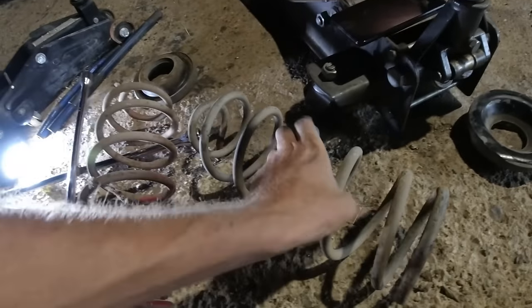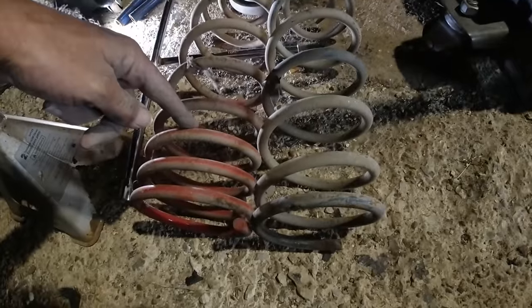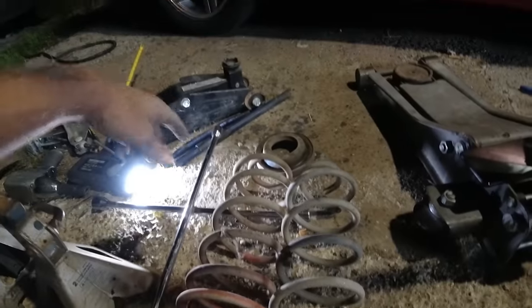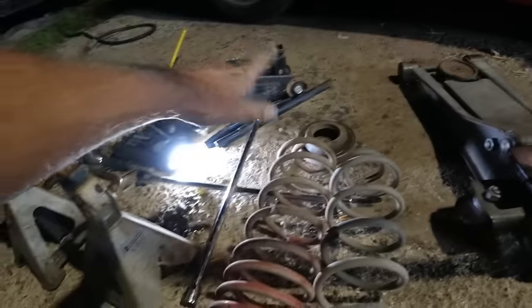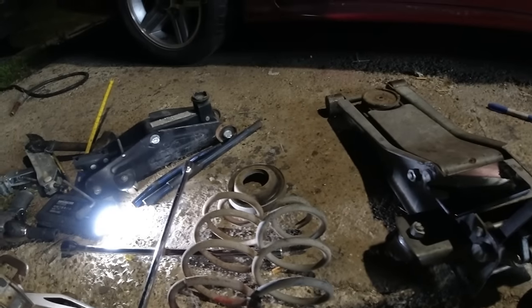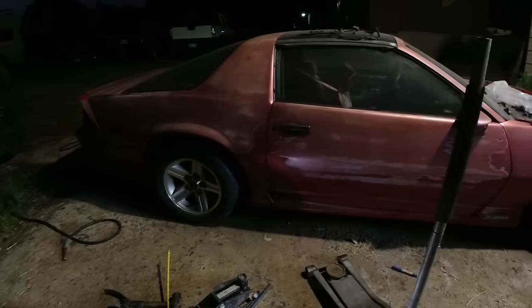Here's the one that just came out — they look the same height, but you can tell these ones are more compressed together. I went ahead and put that one in and raised it up one inch — it was 27 inches, now it's 28. I guess they're different tension, so I'm going to put this other one in and then we'll deal with the front when the new front ones come. We raised the rear end up an inch, so that's good.